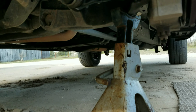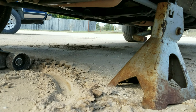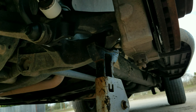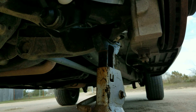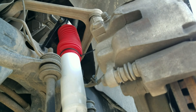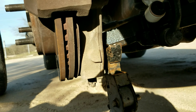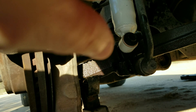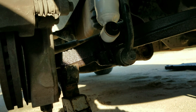What you'll need to do if you decide to change the shocks on the front: put the other wheel back on the front. Don't take them both off. Take the stands out from under the frame, and put the floor jack under this crossmember right there. Then put a small jack right underneath the A-frame, because you will need to compress the A-frame in order for the bolts to line up — especially that bottom bolt of the shock.